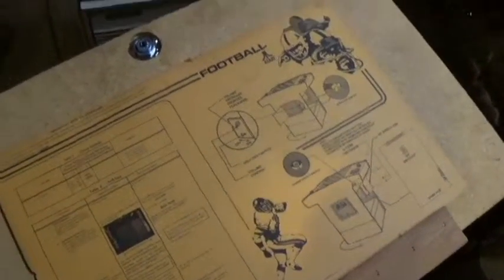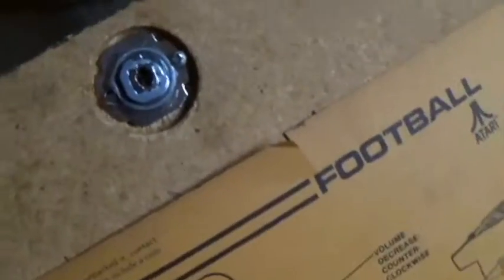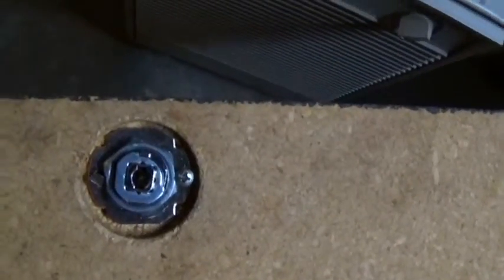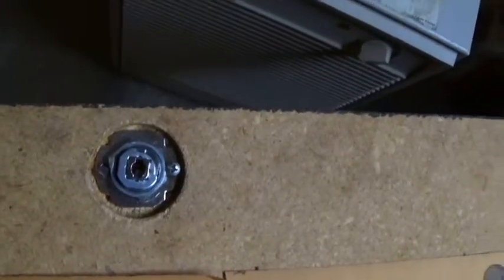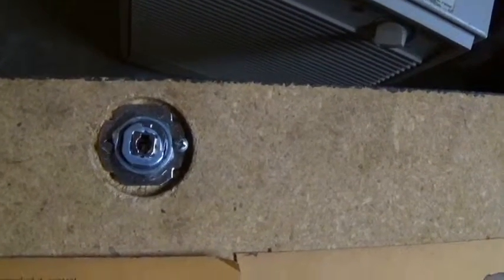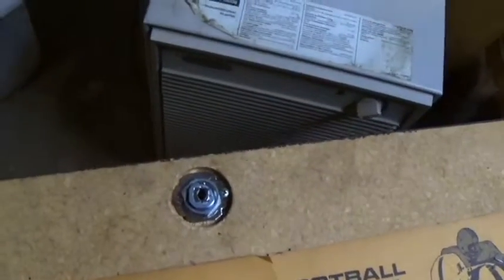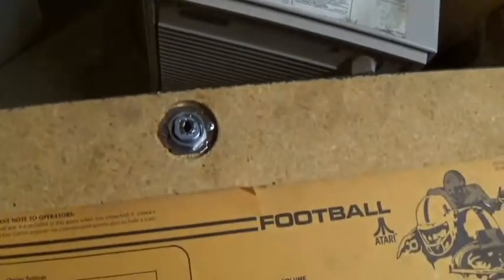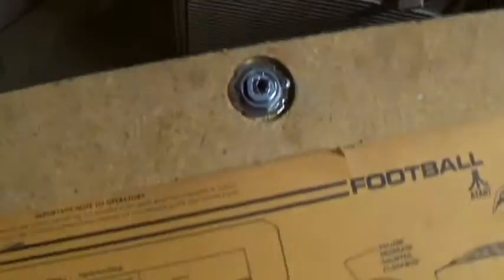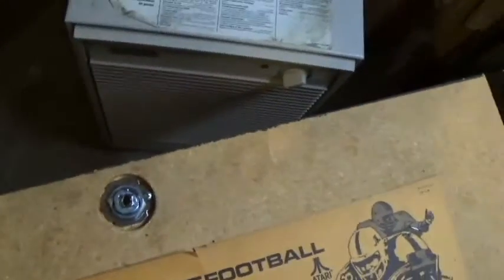This is the inside of the service door. This would have gone okay. There are a couple of small screws that don't match on either side of the lock, on the right and the left, that are holding down that metal piece underneath, which provides a little bit of backing for the nut around the lock to go down on, but initially they were kind of halfway underneath the nut that had been there. So I had to get them out first before I could unscrew the lock, and then when I got it back on, the new lock didn't want to go in because it was just thick enough between the thickness of the board and that metal piece that there wasn't enough threads left on the shaft of the lock